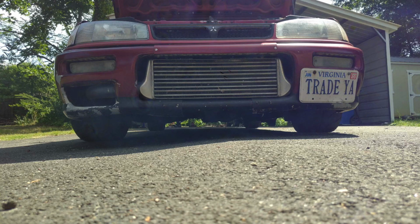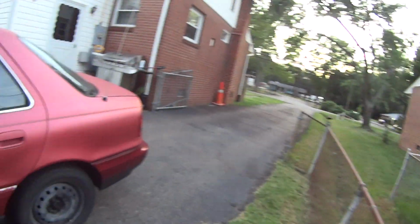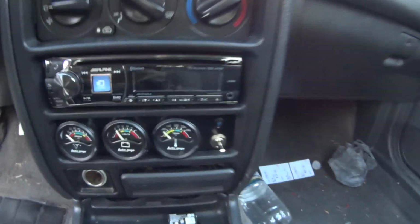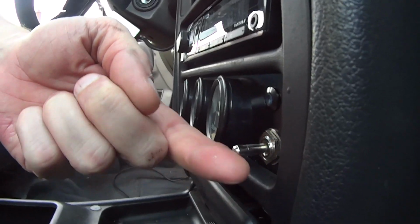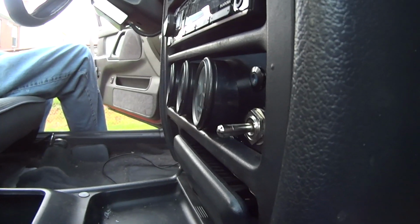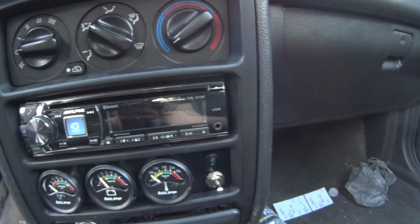You can't see it from the front, from the back, or the side. The wires go up through the floor pan into the dash where the controller and the switch live. I'm going to revisit this after the shootout for a grommet and some extra protective gear, but the switch is a 2-position momentary switch. It's mounted so that up opens and down closes. It hangs out in the middle in neutral. This steel plate that I made is the ultimate mounting location for the switch. It's clean, somewhat unobtrusive, and very accessible on race day.